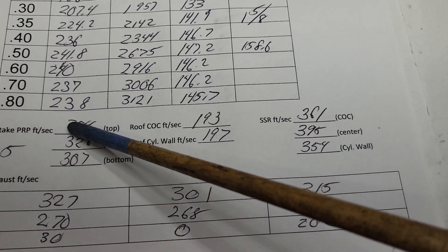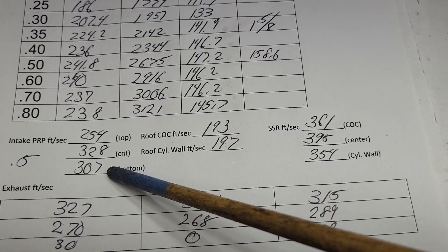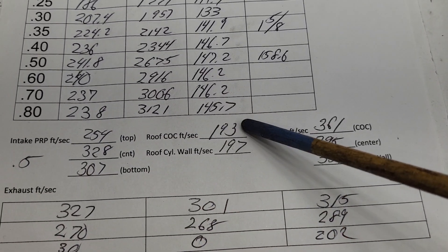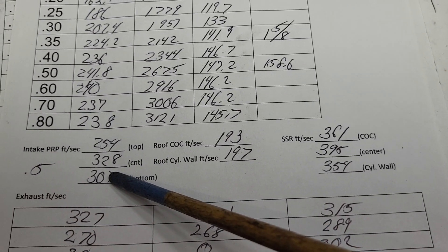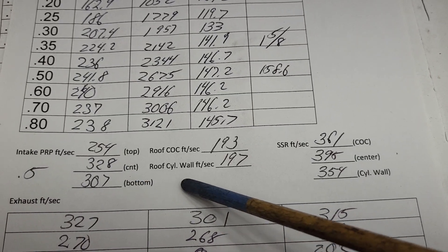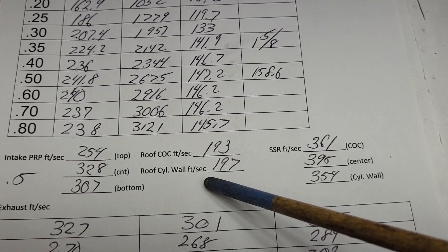Take a look at our airspeeds — pretty darn high. We did these at 500. I don't know how big a cam he's going to wind up using, but I figure at least a 500. I'll do more than that in a pickup truck. A little slow on top. Unfortunately the pinch on these — they kept the same, they're very thin on the pinch. So you're not going to be able to gain that much unless you go up, down, and towards the center. Maybe I can take 50–60 thousandths out of that pushrod side — I'll have to look at it.